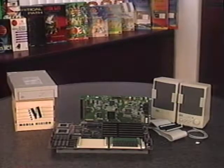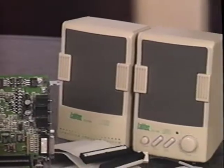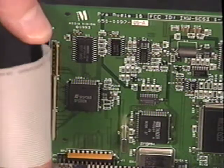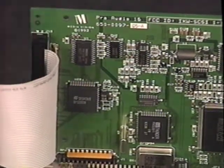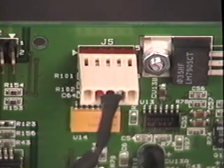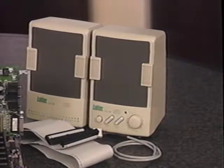We're going to start by showing you a clear picture of the parts that you'll be using and how they connect together. This is a display of the parts and connections. The main parts are the sound card, which plays sounds from your computer through speakers or headphones. The card also controls the CD-ROM drive, which reads data and audio CDs. The sound card and CD-ROM drive are connected by a wide interface cable and a narrow CD audio cable. The sound is played through speakers.